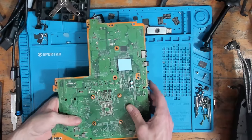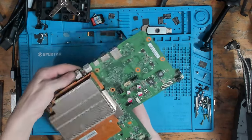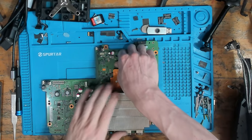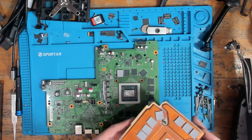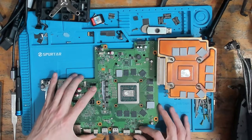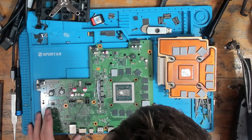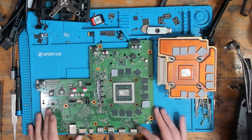Because this has got liquid metal, I'm going to hold the heat sink, flip it upside down, and try and get the board as flat as I can. Yeah, there's not enough on there — that's why it's overheating. Right, yeah, nowhere near enough on there. I'm going to be honest, I don't know if it's wise having those capacitors on the APU unprotected.